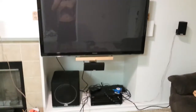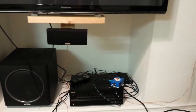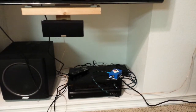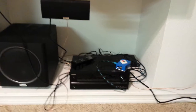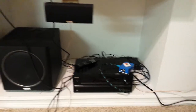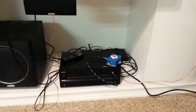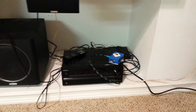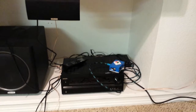This is my basic home theater setup right now. I have this receiver. What's awesome is I was playing with the Raspberry Pi, and it has built-in CEC. If you don't know what that is, I think it uses pin 14 or something on HDMI, and it can send commands over it. I was actually using the TV remote to control XBMC on the Raspberry Pi. It's pretty awesome. I have a CEC adapter I bought a few years ago from the company Pulse-Eight. It was like 65 bucks or something, and it has HDMI and USB, and you plug it in, and then you can send CEC commands, and I think you can receive them too. I'm not going to use the Raspberry Pi forever. It's pretty janky. It's pretty slow in the interface because it only has like half a gig of RAM. I'm going to obviously build a legitimate home theater, but I was just testing yesterday and calibrating the TV.